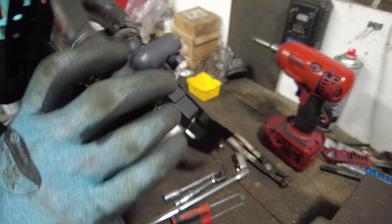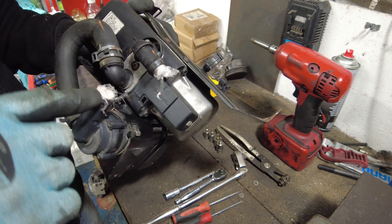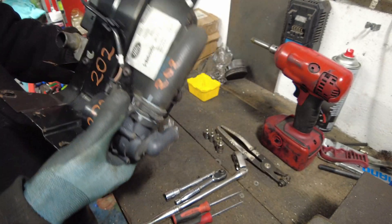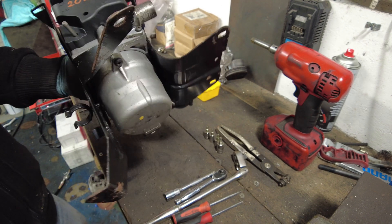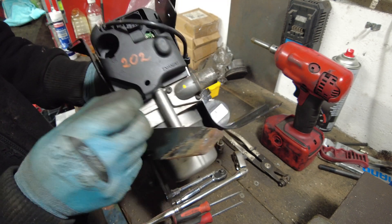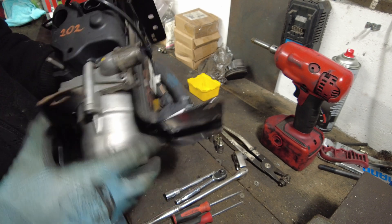So this is the coolant circulation pump. Coolant in from your engine, burns diesel, heats it up, pumps it back out to your engine. There's a fuel input, the exhaust and the air input and connectors.